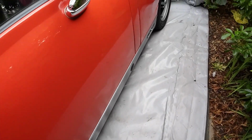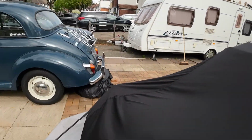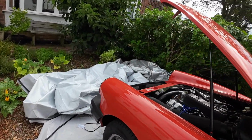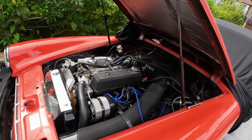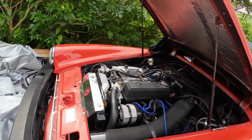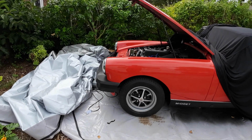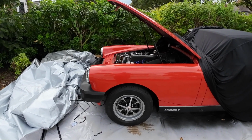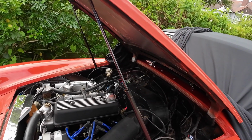Hard for you to see, but yeah, there we go. I had a slight issue with the Carcoon last night. For some reason it went off and deflated, but before it deflated it flattened the car battery completely, which is what it's supposed to do, but I can't work out why it went off. It's plugged into an RCD and the RCD had tripped. We tried the RCD on something else and it tripped as well. Plugged the Carcoon back into the normal plug and it worked fine, so not entirely sure whether we've got a faulty RCD or what, but I'll have to get another one.